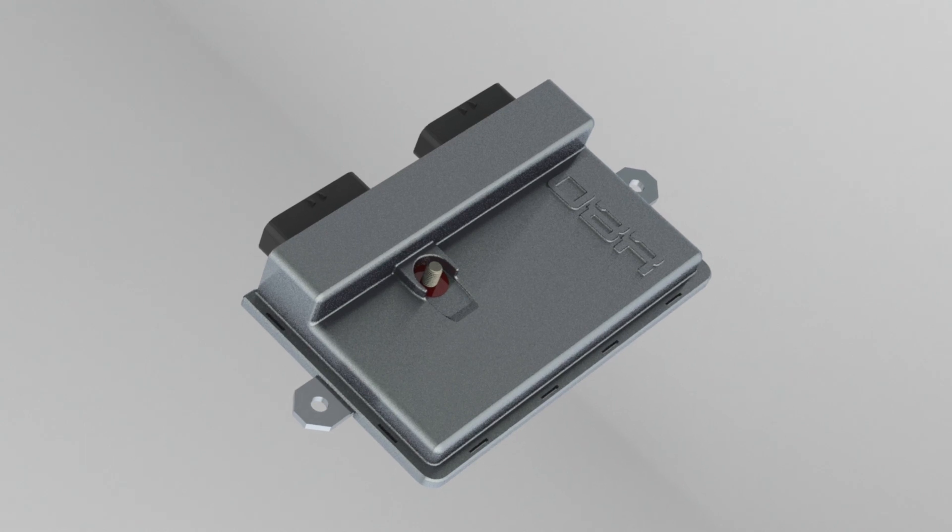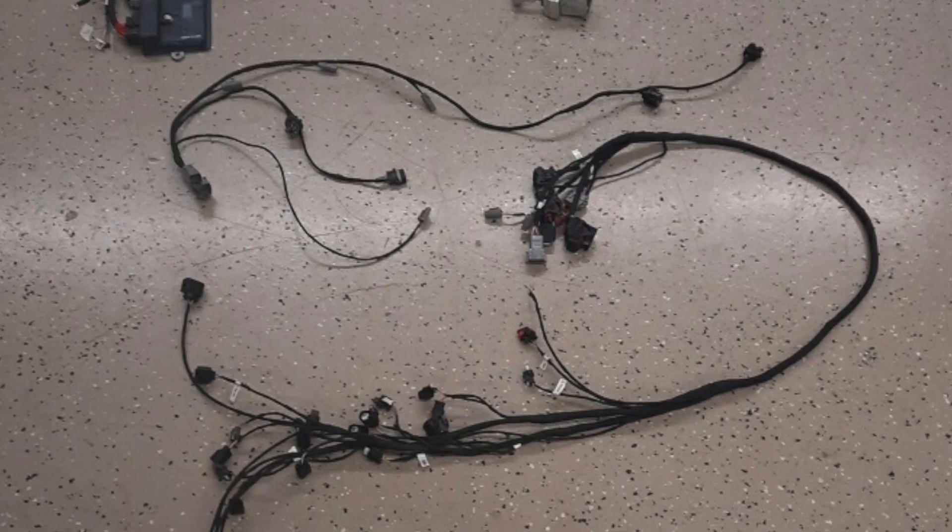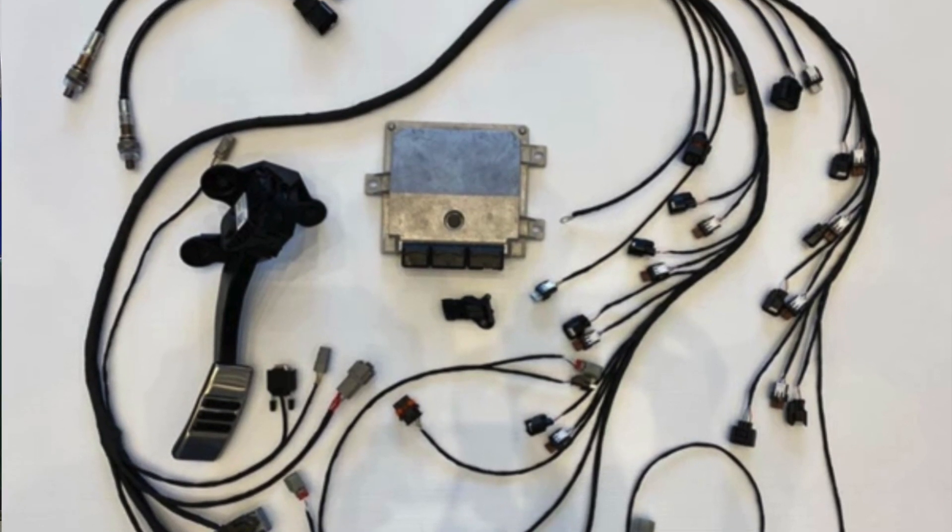The last question is about physical wiring complexity. It's a sophisticated box, but you don't need relays or complex circuitry for cool features. If you can wire up a regular fuse box, you can wire this system up, no problem — it's probably even easier than making a conventional fuse box work. Every relay can be overridden from your laptop, so you can test every individual circuit: does the fuel pump turn on, does the right headlamp turn on?